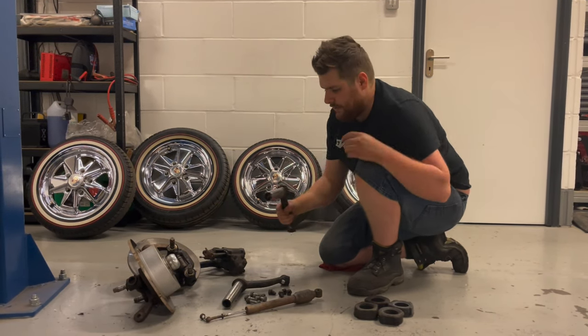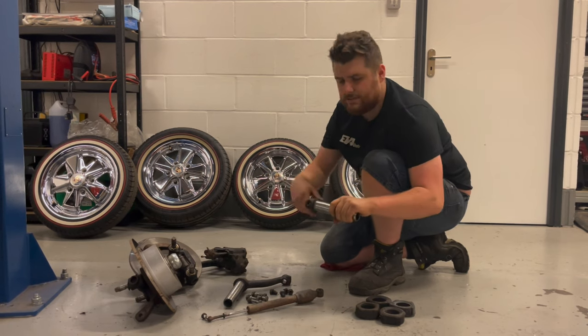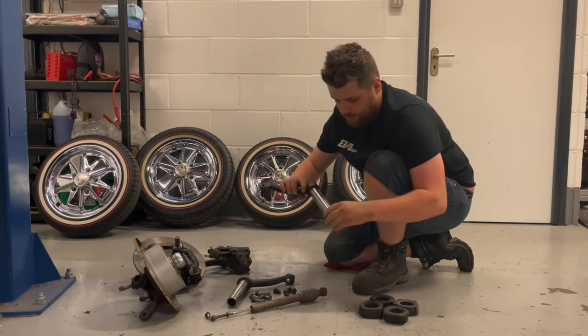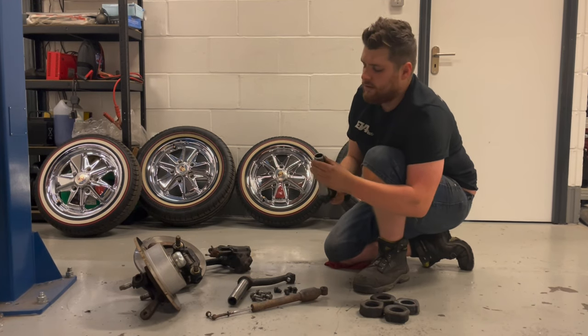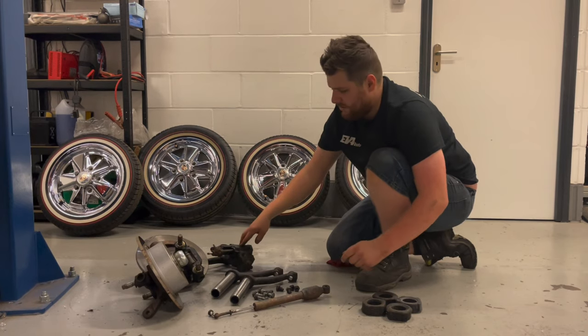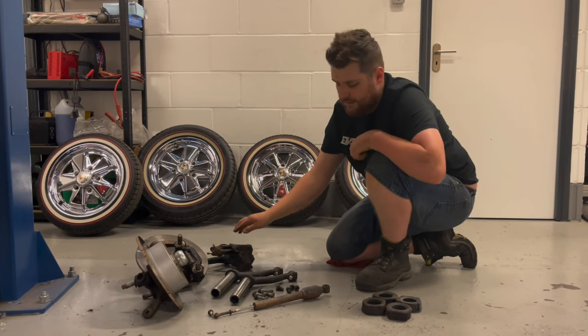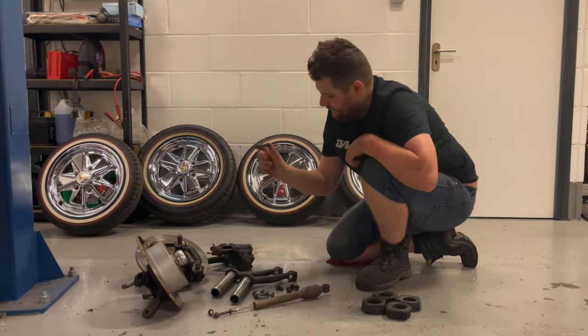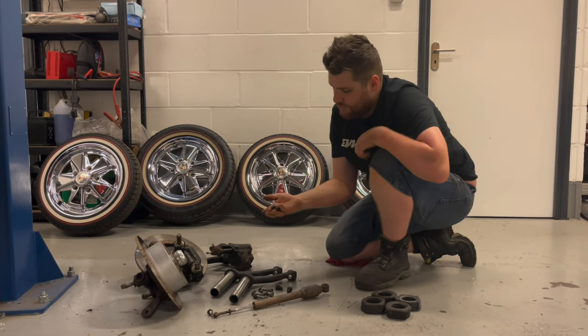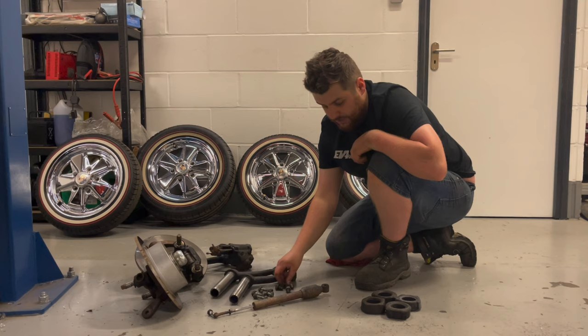The original torsion bar, well, trailing arms, you'll need these, give these a bit of a clean, paint up. Make sure they aren't scarred or damaged or anything like that, because if they are, it's not particularly good for the bushings in the beam. Original steering box arrangement and pitman arm and clamp, you're going to need to reuse that. Pinch bolts for the link pins, they're a good idea to reuse. Obviously grub screws for the torsion bars as well, we're going to need those again.